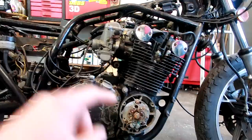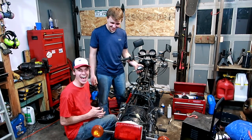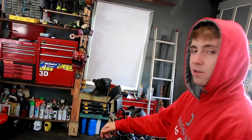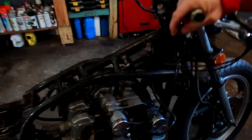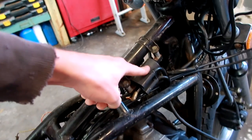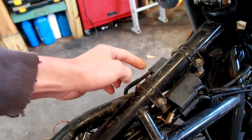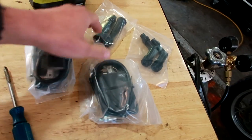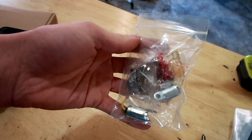The only screw that's probably original is this flat head right here. As you saw when I did buy this bike, it had compression. What were the numbers Jake — do you remember? 110! Next cylinder — around 120. Lubed up, all the cylinders were at about 120 PSI. I ended up doing a test on the coil packs and both coil packs are shot. So we dug deep into the wallet, got some parts. Here's both coil packs, new boots, and here's our points and condensers.